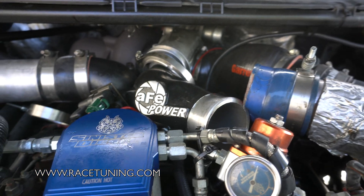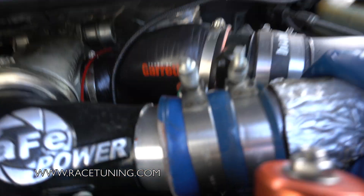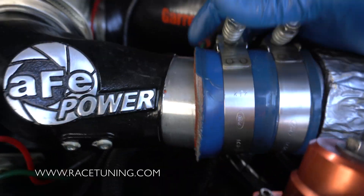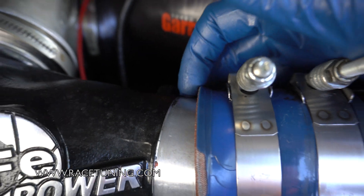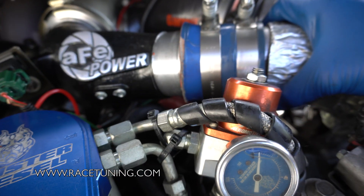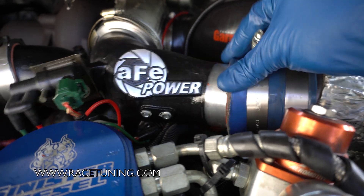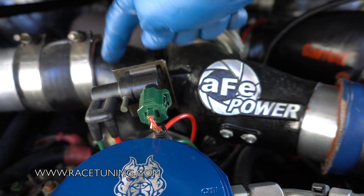It's starting to go back together, and you can see right from the get-go that the alignment from the boost tube is off — there's a big gap in the front and it's pretty tight in the back. You try moving this intake up and down and it doesn't make it any better. Move it up and it's a little short; move it down and it starts to contact the exhaust side, and that's after it was grinded.